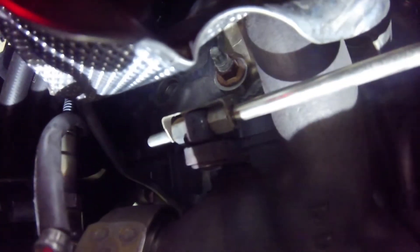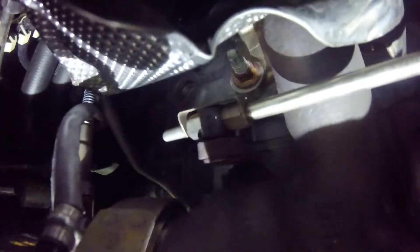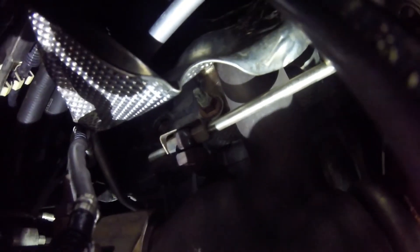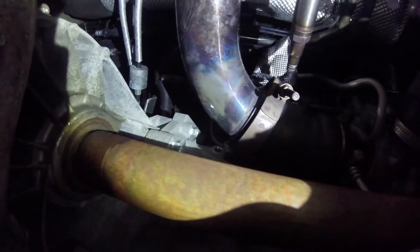The other nut is tightened down all the way to the right and the retaining clip is back on. So basically you just need to do the reverse of what we just did — spin the heat shield back down into place, put the bottom bolt back in, and reinstall the top bolt if you removed it completely. Then hit up your tuner and have them adjust the tune to accommodate for this — you definitely don't want to run this without tuning to adjust it.